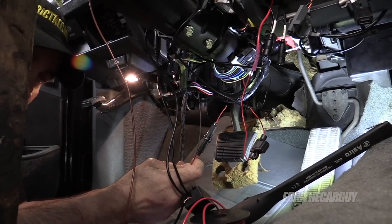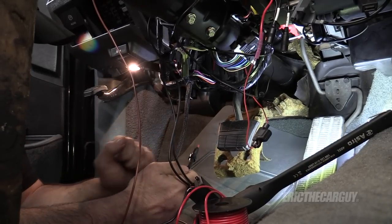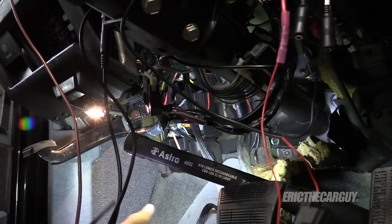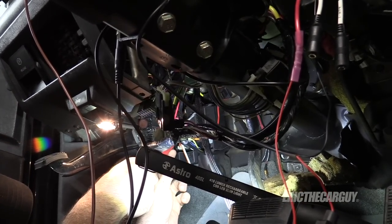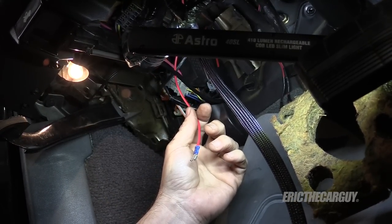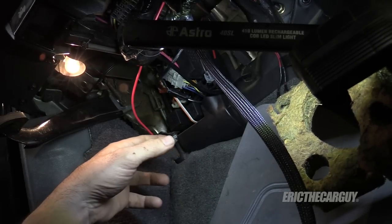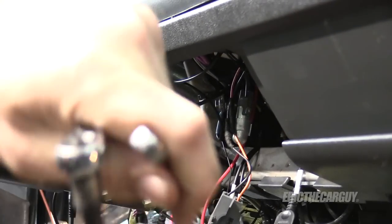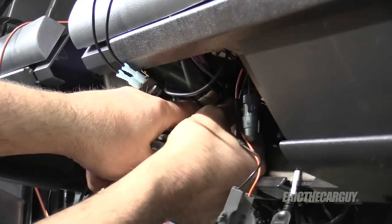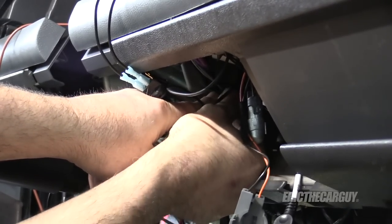So the O2 sensor wiring passes through the firewall. This is going to stay inside because I need to wire it up to an ignition hot source and a ground. I need to keep this inline fuse in here because that way the circuit is still fused — the O2 sensor heaters can draw some amps. I'm going to piggyback onto my other one — taking this ignition hot source and piggybacking the wire for the O2 sensor into it. You might remember this being the ground I made for the exhaust cutout. I found out that the exhaust cutout was tied into that ignition hot circuit, and I think that is ideal for this. The exhaust cutout is not going to be active all the time — they're both coming off the same deal. I have supreme confidence that this will work out fine.